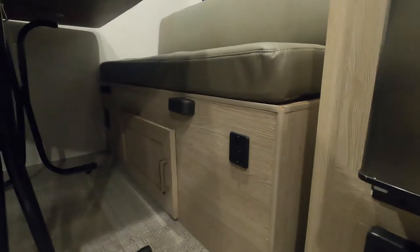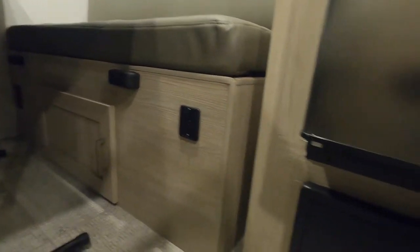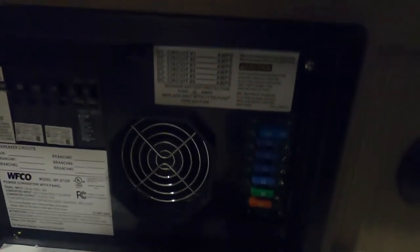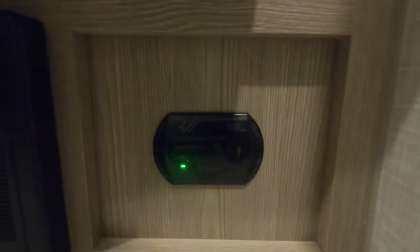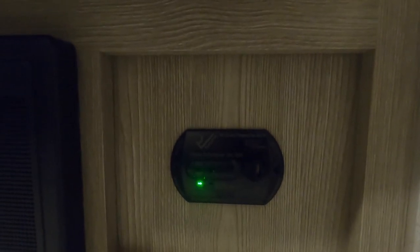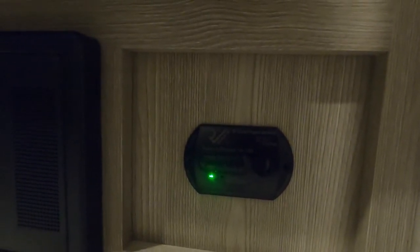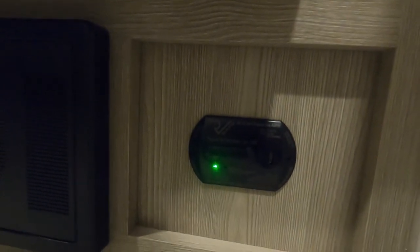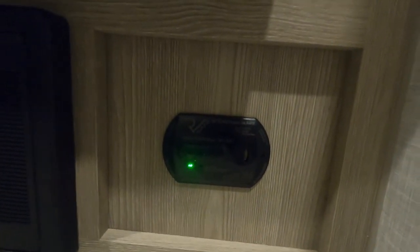Underneath your seating, this table will fold down and sit on these lips — I'll put it like that for travel. USB ports here. Underneath your fridge is your access panel to your breaker box and fuses — yellow variety, 15, 30, 40 amp. I recommend having a handful of those with you when you go camping. Just to the right of that access panel is your 12-volt carbon monoxide detector. The reason I mention it's 12-volt is it's always running off your battery, so if you're going to be gone for the day and not plugged in with nothing charging your battery, disconnect your battery post using the battery disconnect to keep it from running your battery down.